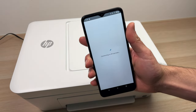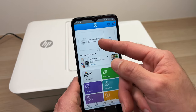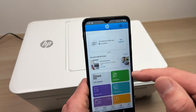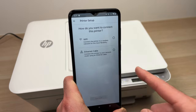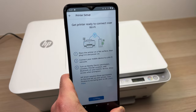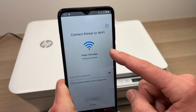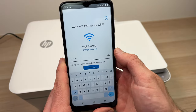Open the HP Smart app you just downloaded. This is the main menu screen. If you don't have any printer connected, you'll see a button saying 'Add Printer'. If you don't see it, press the small plus button on the top right corner. Then press 'Get Started', select Wi-Fi, and press Continue. Select DeskJet 4100 series. Make sure that the network shown is your home or office network, and enter the Wi-Fi password. Then press Continue.